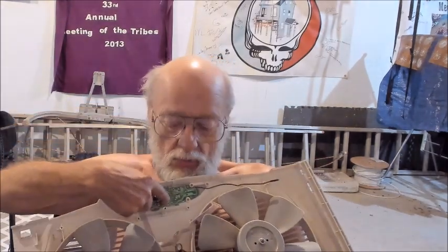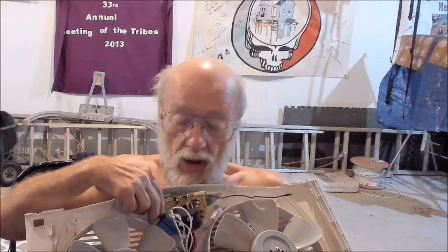This logic board out here on the back side is the button logic board. Again, 3 functions on this board: convert from 120 volts down to whatever power is being used by the control board, a set of relays which the control board can control with 5, 8, 10 volts direct current, and the required run capacitors for the 2 fans. And that's it. That's enough for today.